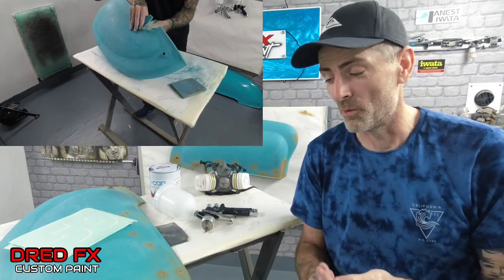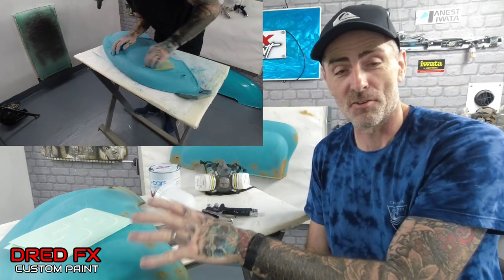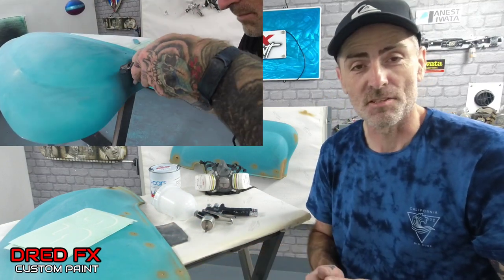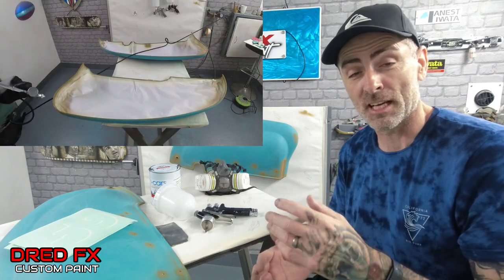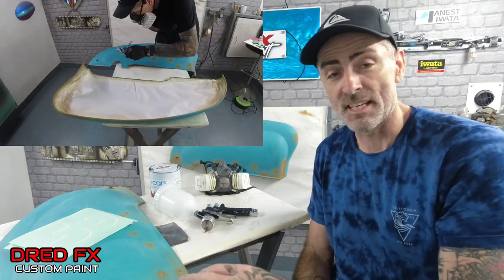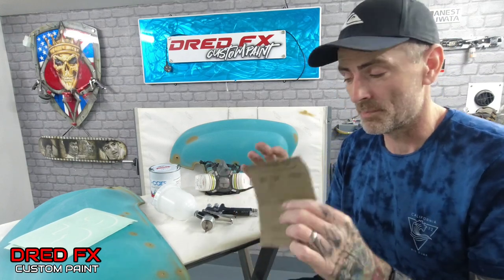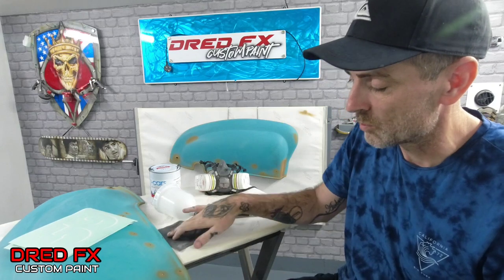I finished off in part 1, we've got these prepped to 320. We cut out the vents for the sides for the airflow and we finished the actual episode off getting these into epoxy primer. Now moving on to part 2, the first things we're going to do on today's video is go back in and prep these again, but down to a P800 wet and dry by 3M. So that's a wet application this time. Instead of doing a dry sand, we'll wet the paper up, wet it over, get a nice flat surface